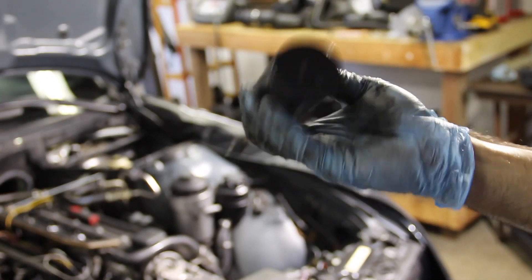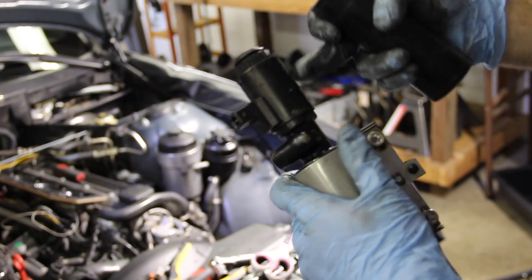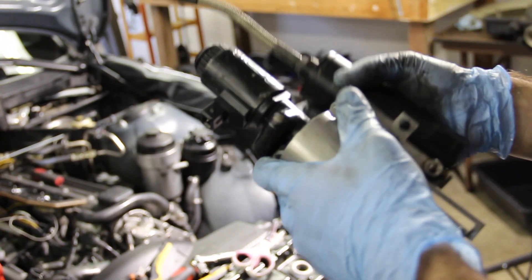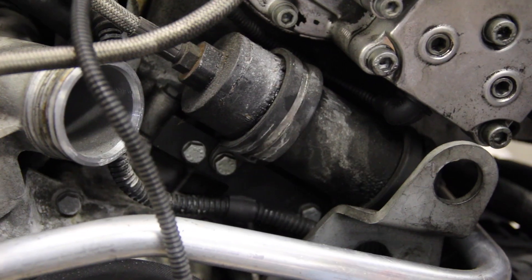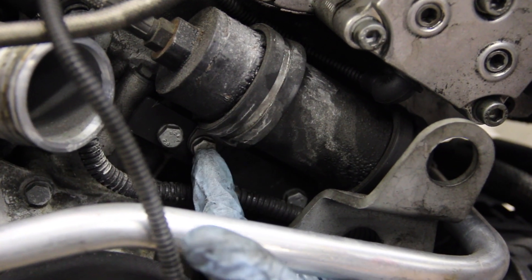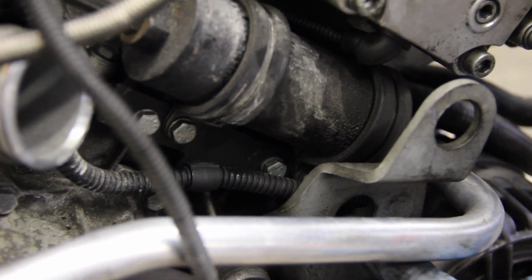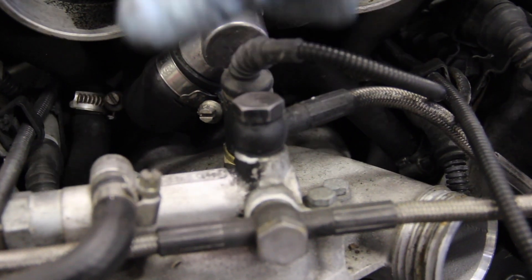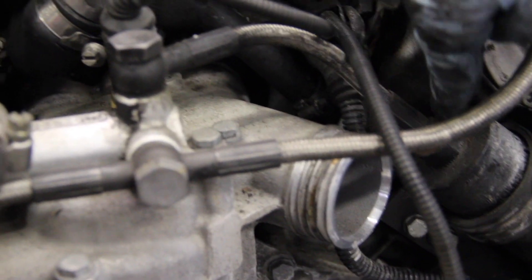We just got the old part out — here's what it looks like, and here's the new one. Up here is where the connector is; it's a type of solenoid that holds pressure, which takes away the rattle. We're using an S62 that's already out of the car to show how to remove the old one. There are two 10mm bolts — one at the top and one at the bottom that's hard to get to; get your socket through the bottom hole to loosen it. Those two brackets hold the accumulator in. Once the bolts are out, undo the fitting — I believe it's a 13mm — and the accumulator slides out. The hose appears permanently attached, so it all comes out as one piece.